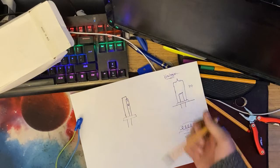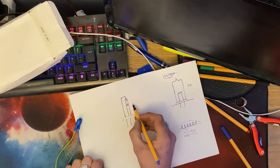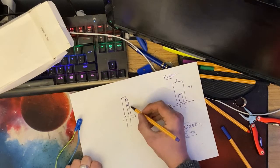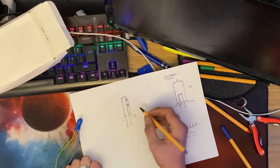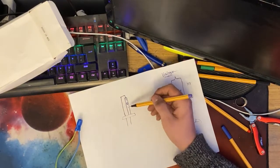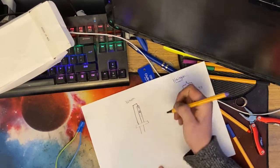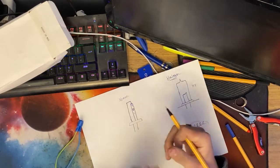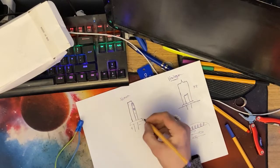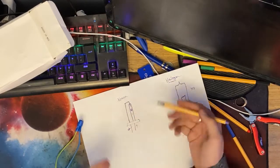And the reason for that is the way xenon bulbs create light. Xenon bulbs work by an electrical arc. So instead of a cable that gets so hot it glows, this is actually an electrical arc, which is basically just a big spark. This is generated by a big spark, which just excites the xenon gas and causes it to light up, and very brightly at that. Now, this could be positive, this could be negative, or this could be positive and this could be negative. It doesn't matter. This bulb itself doesn't care what polarity.